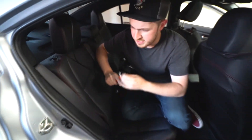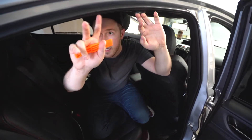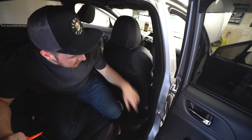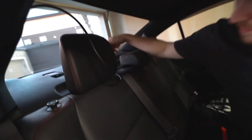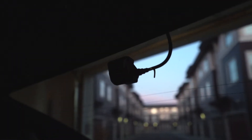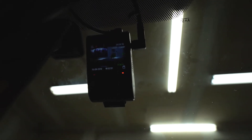Because this wire was so thick it wasn't fitting well under the headliner piece, so we went down that pillar and along the bottom trim. Using a trim tool you can pry it up and wedge the wire underneath — went underneath here, up here, going under this pillar — and we tucked it in up at the rear where the camera sits. The length is actually perfect. You can see up there where we mounted the rear camera. The car is turned on and the cameras are working, and when we turned it off the cameras stayed on recording, so we know parking mode works.